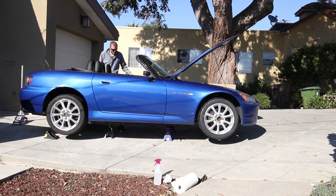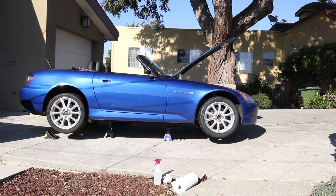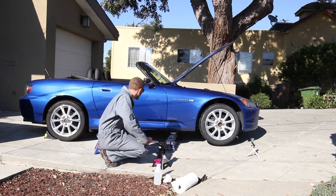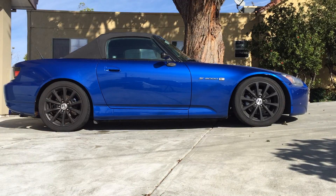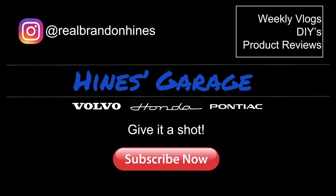As you can see, this KW suspension is a three-way adjustable suspension — from rebound to compression to ride height — and I am excited to give it a go at Thunder Hill. Handling isn't all about suspension but also about tires. I am going to go with the RE71R tires, 225 front and 255 rear, because it might rain and I do not want to use my NT01s.